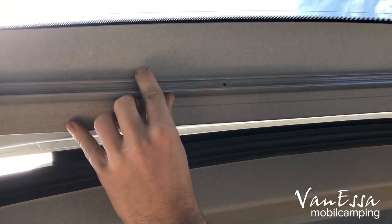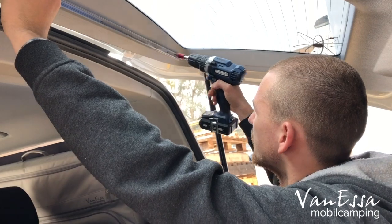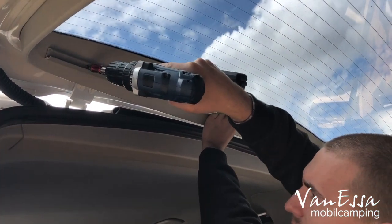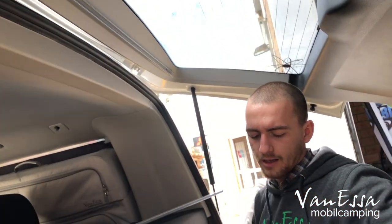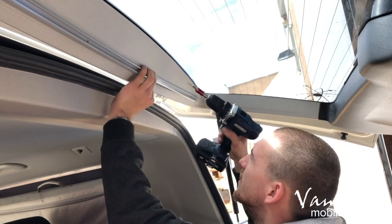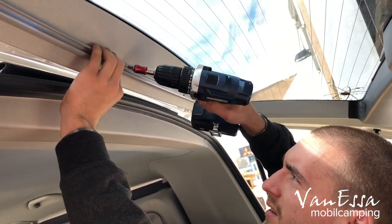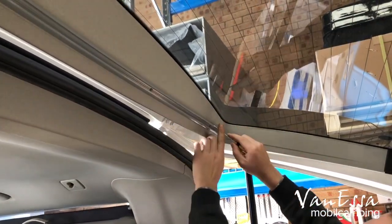It screws in — we usually put the first screw in the middle, then put the right screw in first, followed by the left screw. We make sure this line is at the edge. Then the third and fourth screws go in the middle. We bend the rail to follow the same curve as the trim, fit it in, screw it in, and the top rear rail is on.